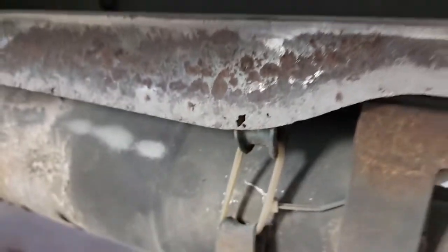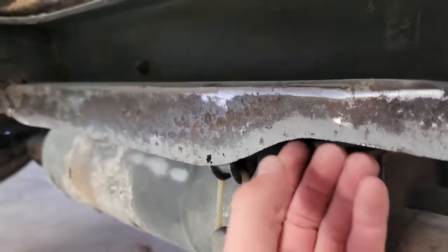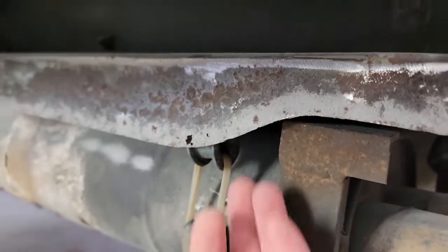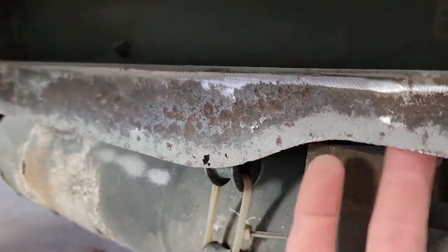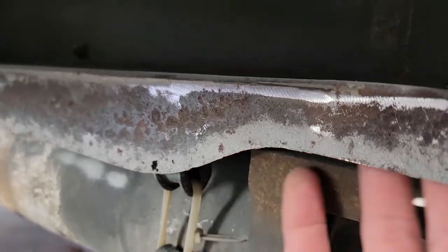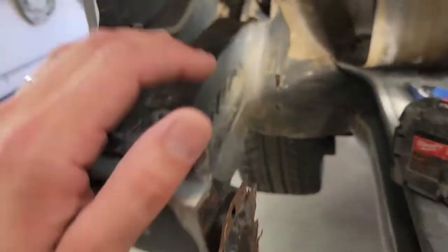See how that's just rotted away. I'm going to clean the rest of that surface rust up with a strip disc or grinder, and then I'll just panel bond all of that. If I weld through this, it's just going to go right through it — there's already some holes. So that'll keep me from burning the paint off the back side, which I'll have to coat anyway just to make sure there's no rust. I'll put 415 back in here, most likely panel bond this, and seam seal all around here and all inside. This will be the simplest way — just drop the whole piece in.